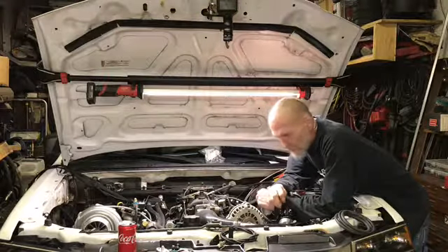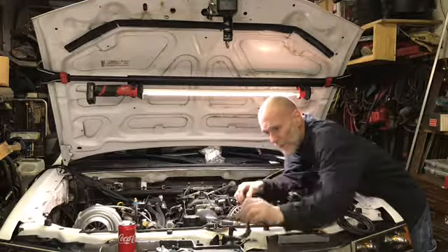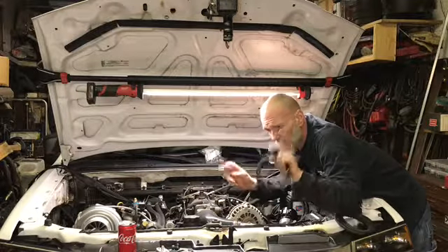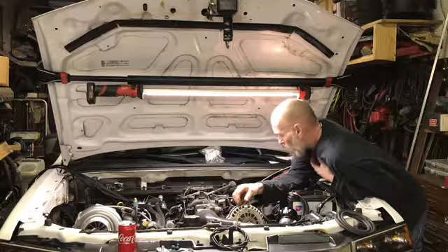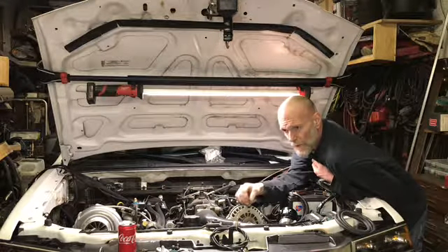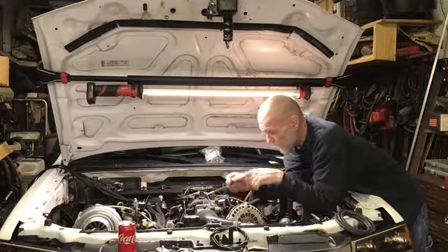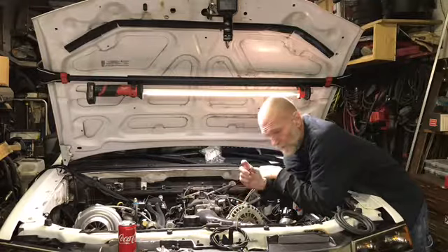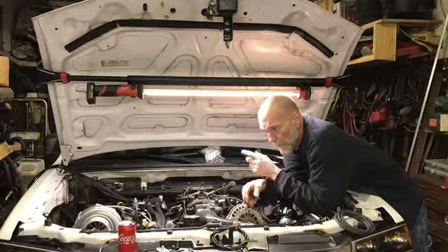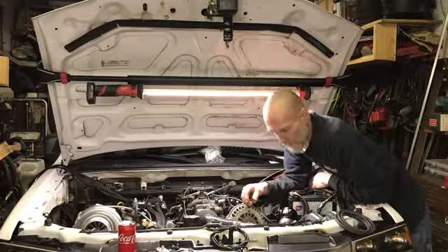The oil pressure sensor that was in it is from the '02 or '03 Yukon XL that I got the harness out of, and it is a single wire. That single wire I do believe is for an idiot light and not really oil pressure data logging. So I have a new sensor and I have a LS cut harness that we got with a used motor — they cut it right off the computer, so I have all the pigtail ends. That's why I got all the new injector plugs and connectors. So I'm gonna get to taking the sensor out, we're gonna put the new sensor in, we're gonna go get that connector, wire it into the computer, and hopefully it works.